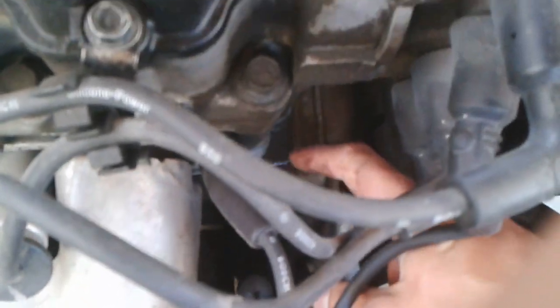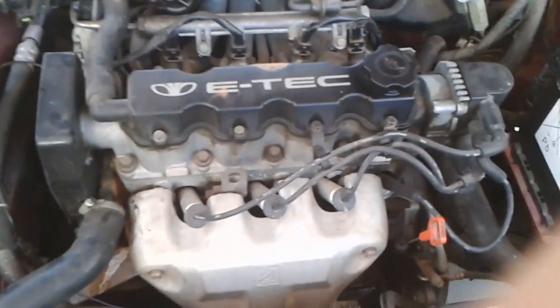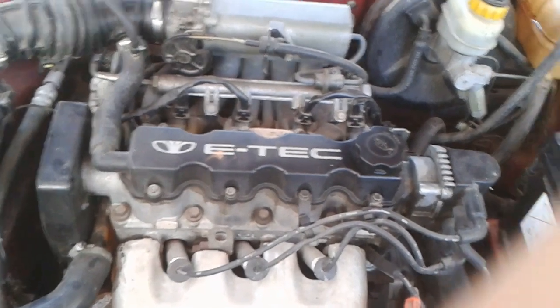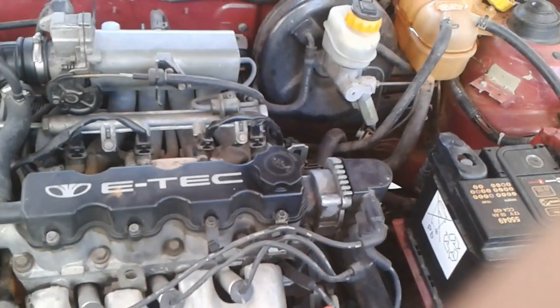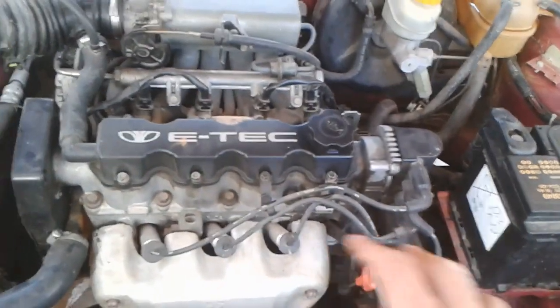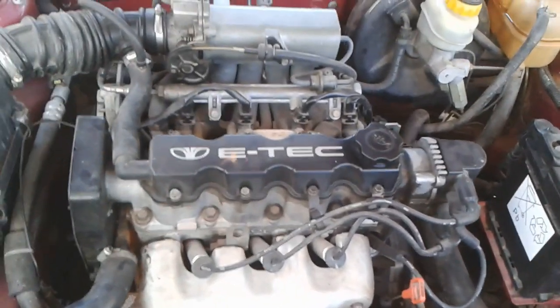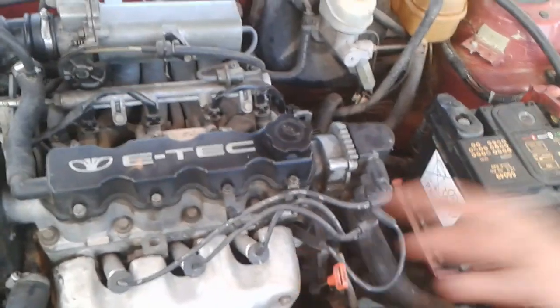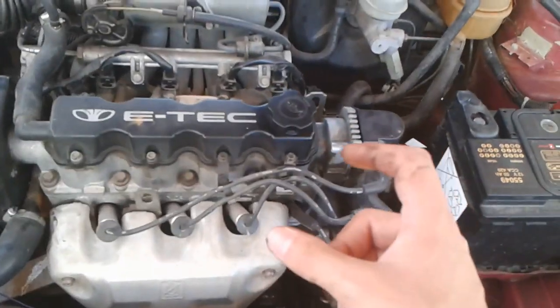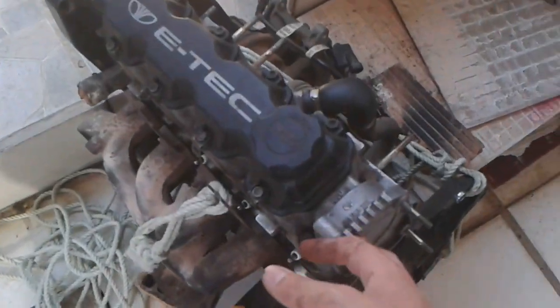You can see the difference - this one is leaking oil and water on the outside. Anyway, I've got the other engine, hoping to put a turbo or supercharger in it, but I can tell it probably has a few hundred thousand - better not say half a million - kilometres on it. That won't be a good idea; the compression won't be good. The static compression might look okay, but if you add load at high RPMs the whole compression changes. It leaks on the cylinder rings, so the turbocharger project on this engine will be scrapped.